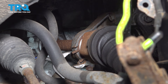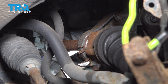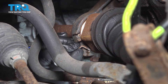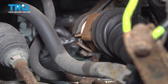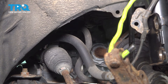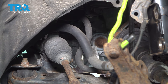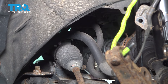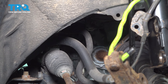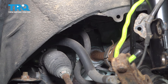Using a pair of pliers, remove the snap ring for the intermediate bearing. Remove the snap ring and make sure that it'll float around. We're going to remove the CV axle. Before you do this, be sure there's a drain bucket under the hole right here — it may leak fluid. We're going to use a big pry bar and get under the cup of the CV axle and give it a few shocks with a hammer.